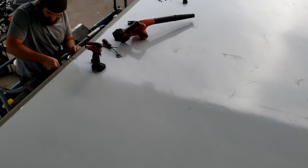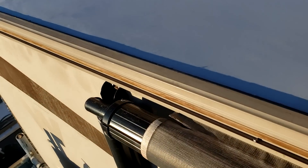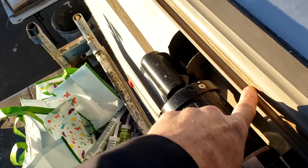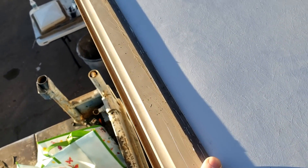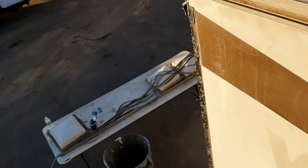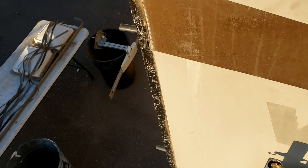It feels very strong — very much like a bull. We'll go ahead and get everything cut down, seal up the roof, and put this thing back together. The edging's all the way on, sealed underneath. The Winnebago has lap sealant right here; we'll be using NuFlex 311 on top everywhere, and on the sides it'll be putty — butyl putty — along with clear 100% silicone sealant.